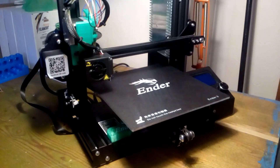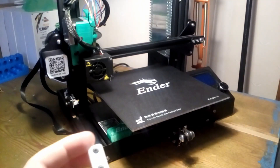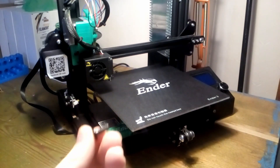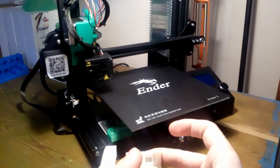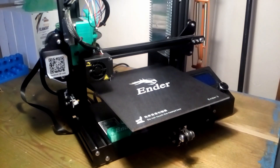You don't need that much hardware for this upgrade. You need to print this adapter I made, which you can download on Thingiverse — print it before you do this. You also need two belt clamps, four M3 by 12, four M5 by 12, four M3 by 8, four M5 lock nuts, four M3 lock nuts, and a 300 millimeter long MGN12H linear rail.